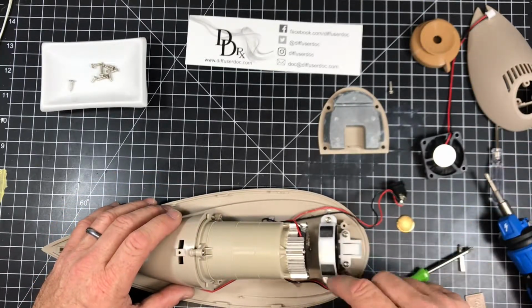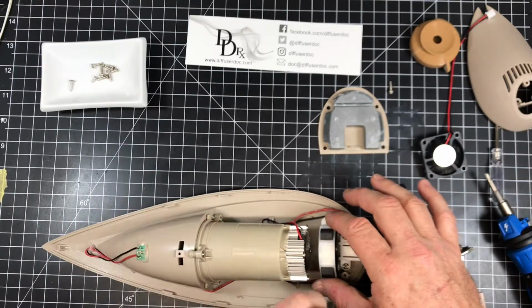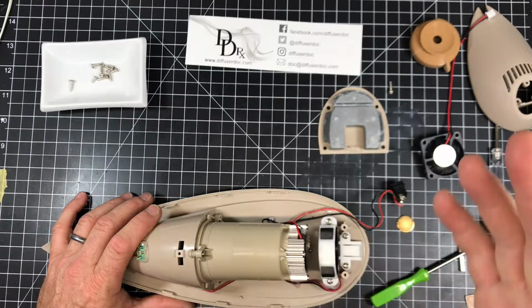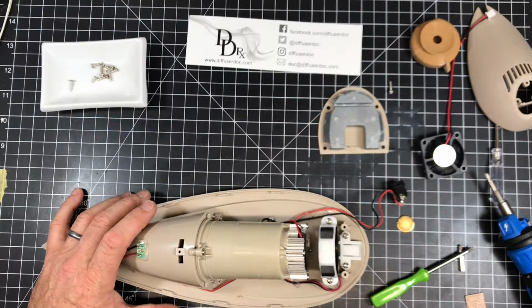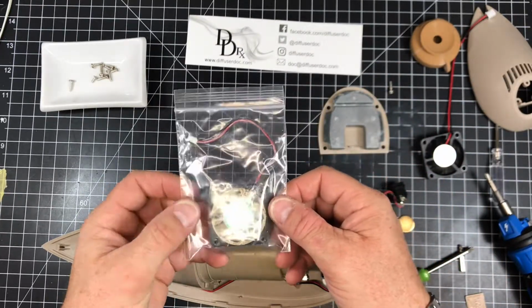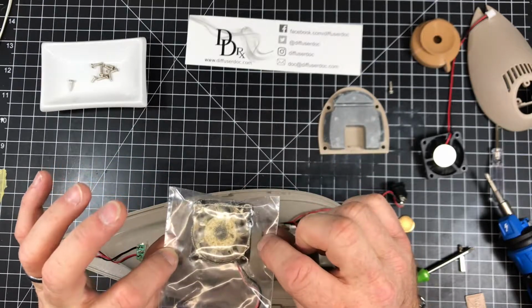Why do you want to replace the fan? If you're seeing mist come out, but it's not blowing out, or you don't hear the fan blowing, chances are the fan's either failed, it may squeal, or it could just be gunked up with crud, or just dust. And this is what a fan looks like if it's full of dust or has just been running for a long time.